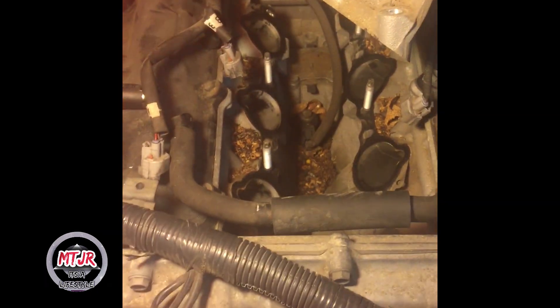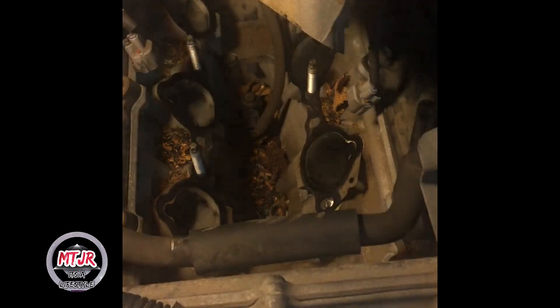You can see right there — that is your knock sensor, and there's the harness that goes onto it. We're going to replace that harness. Honestly I probably should replace the knock sensor too because it looks pretty old, but I only got the code for the knock sensor harness. It's really dirty in here, so vacuum all this out, then it's pretty straightforward — follow the line to where it goes and replace it.